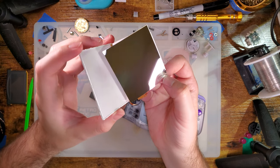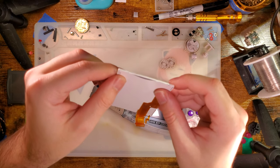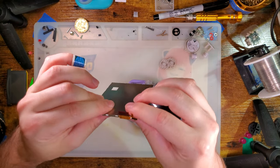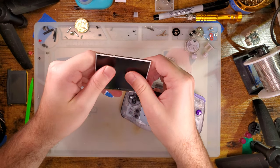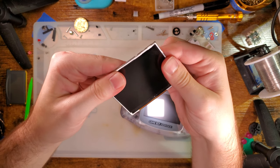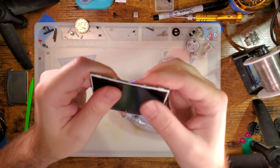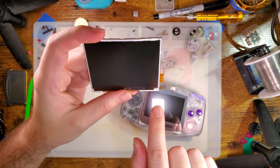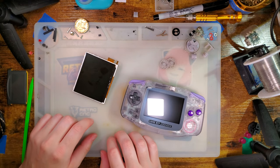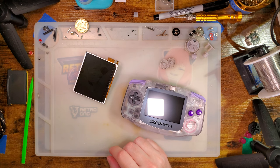Even if screens have to be shucked out of a DSi, junk DSis are really cheap. Since this is the bottom screen of a DSi, there's going to be a touch digitizer over it anyway — once you peel the digitizer off you've got a pristine nice shiny LCD. The only problem is I've seen quite a few DSis with water damage or yellowed screens. Oh look — it's the reflector, so the backlight is along the bottom. Interesting — on older DS screens it was along the side instead. I'll set this back together and probably just chuck it. That's all I've got — links in the description. I'll catch you all next time, thanks for sticking with me.